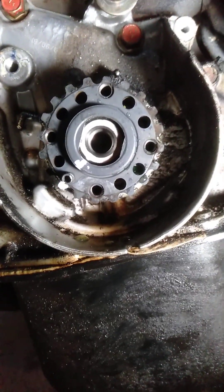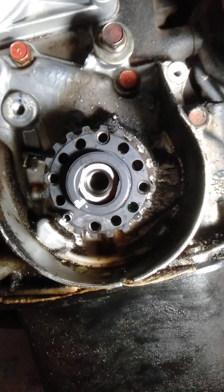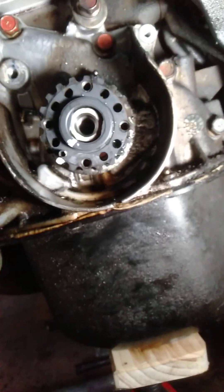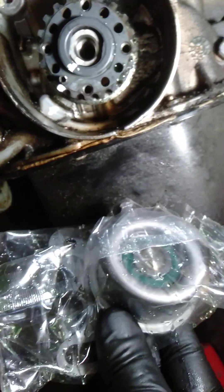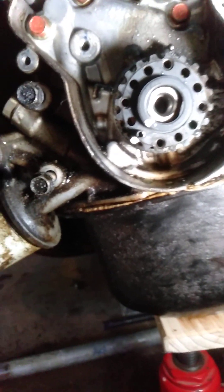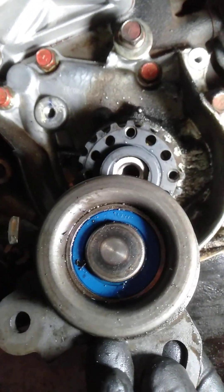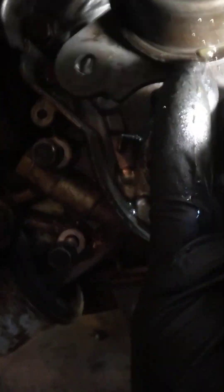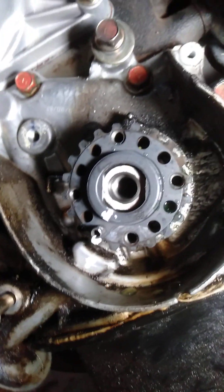I've got a couple of issues with this that I'm fixing as we go as well. It's always good practice to do your water pump — you don't have to, but in the kit they'll give you a new tensioner. I've got a brand new tensioner there; the old one's been removed already. They sit in there, and it's pretty self-explanatory when you take it off.